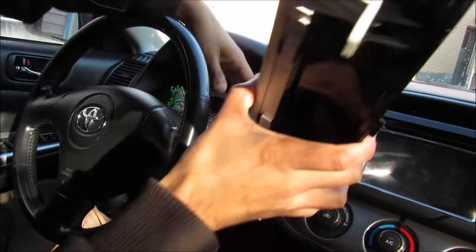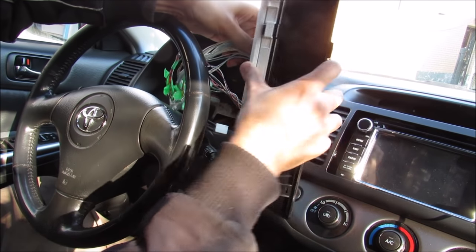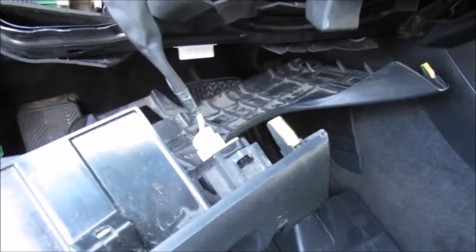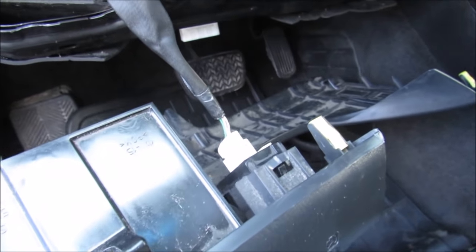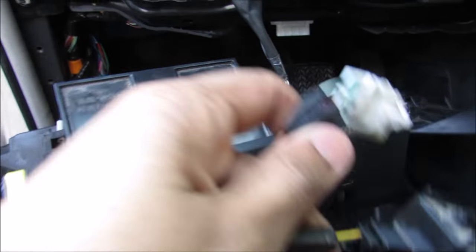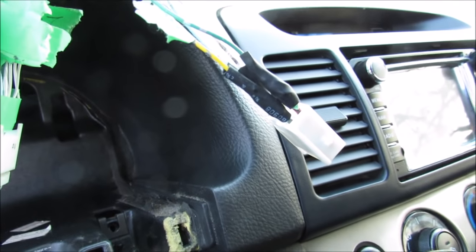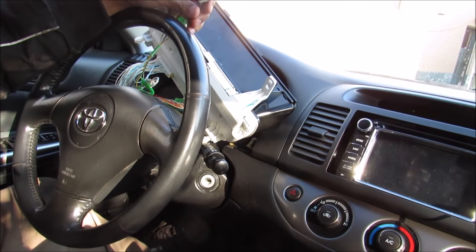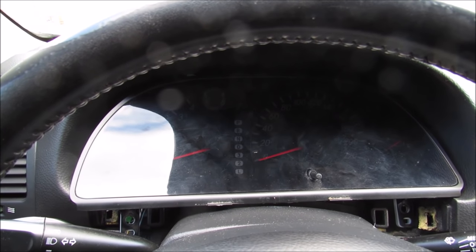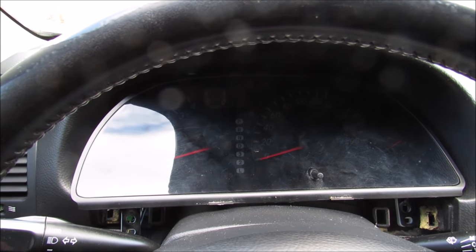Now I can set that inside and plug this side into my new instrument cluster and this into the rheostat. Here's the new instrument cluster — I'm going to plug that in. I've got this dashboard panel free where the rheostat plugs in. I'm going to leave the original on maximum brightness for the rest of my dash lights and then put in this new one into that slot, running the extension wire back up behind the instrument cluster to plug into the connector I fabricated for the rheostat. Now I'm going to plug in my rheostat. I've got everything plugged in and ready to test.